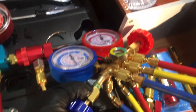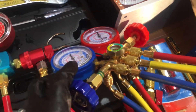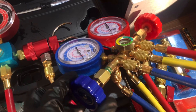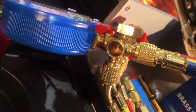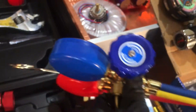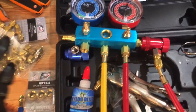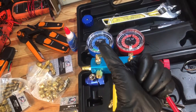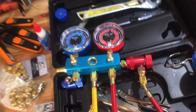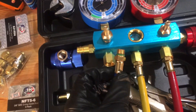I put Nylog down in the shaft to find and stop the leak. I already performed it over here — I put it on all the seals where they meet. This will go back together, down this shaft. That aluminum is very thin, so that'll go back in there. I'm going to repeat yesterday's tests again with the high pressure tonight and let you know the conclusion — showing you what you have to do to get a cheap set of gauges to pass the vacuum decay test and nitrogen decay test. Every one of these fittings I took off and put Nylog around each one, then screwed them back in.